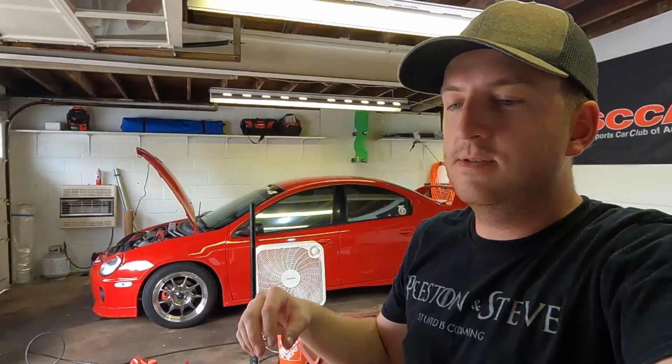Buddy, we fixed it. All thanks to you. So I guess the only issue was that the downstream O2 sensor finally recognized that there was no cat, which was causing all kinds of issues. Like I was saying at the beginning, as soon as my AFR started acting crazy, shortly after that is when I got the cat efficiency code, which, it's been, I don't know, 3 months or something since I deleted the cat on this, and I have not had any engine lights.